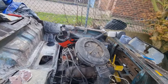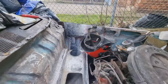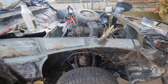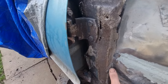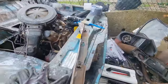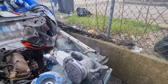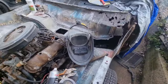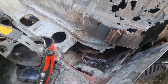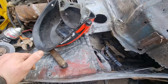The welds are getting good penetration now — they're coming through the other side because I upped the welder power. This side's done. When I take that pillar off I'll put a new lip on the pillar and it'll go over this. I'm trying to decide whether to leave this open for now because it gives me good access. I'll decide in a minute.